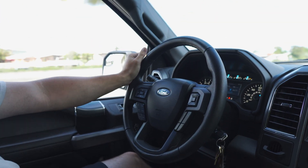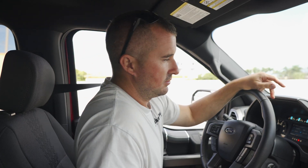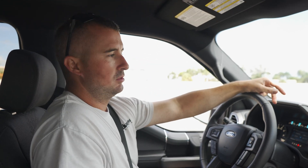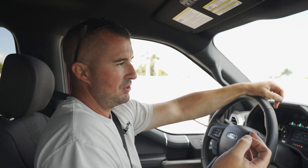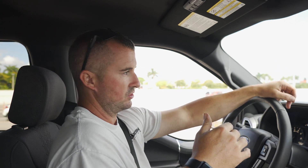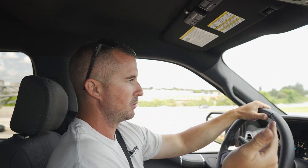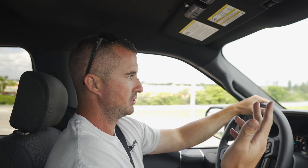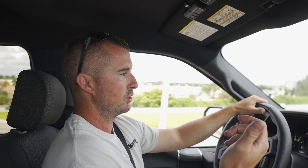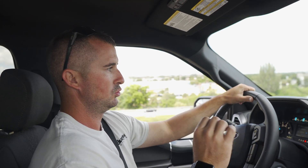It's got a little more balls to it. The install could not get any easier — it took about maybe 45 minutes, and that's without reading directions. It was pretty straightforward: a seven millimeter socket for the factory clamps on the turbo, another eight millimeter for the other clamps. I needed needle nose pliers to pull a hose clamp off — other than that, super simple.